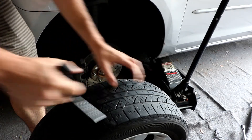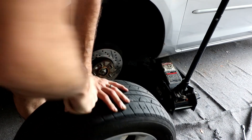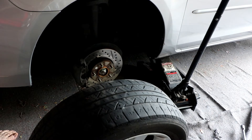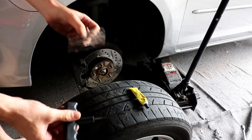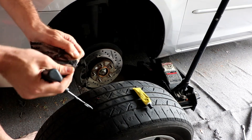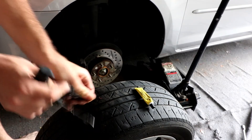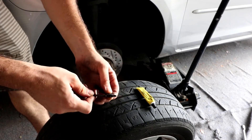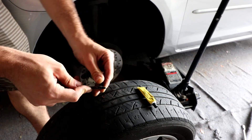I think I got it pretty good — I'll go one more time just for good luck. Now our hole is cleaned up. The next tools we're going to use are the rubber cement, the insertion tool, and the patch itself. It's a sticky patch — pull up the plastic, it's kind of like a really gummy bear. Thread it through the needle on the insertion tool, going halfway through. I've patched four tires with this kit already; this would be number five.